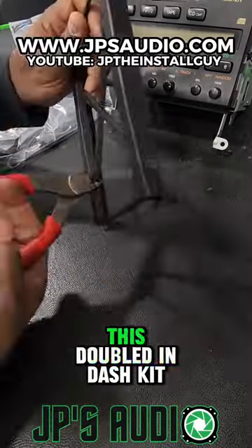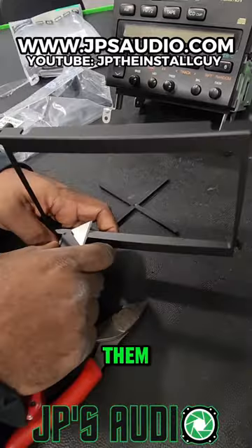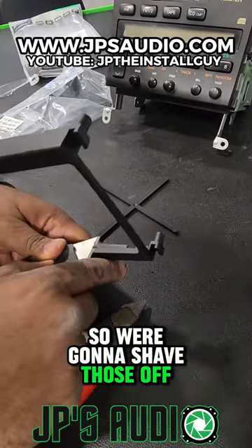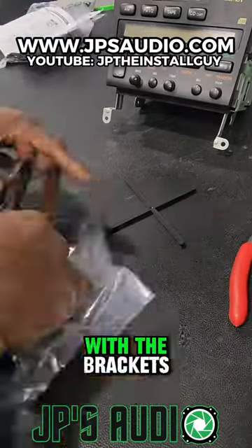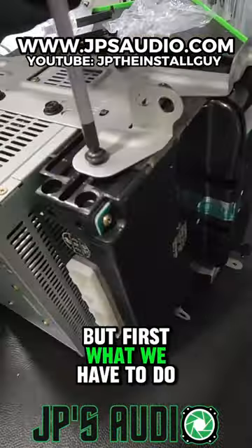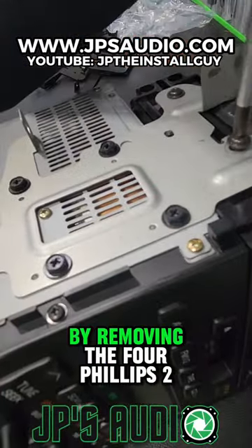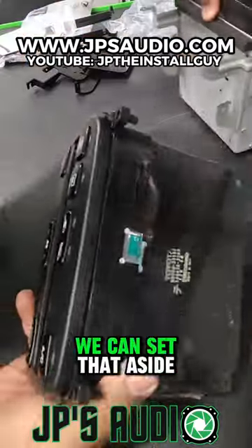Once we disconnect that, now we've got room for activities. We're going to get the dash kit together — this double-DIN dash kit has bars in the middle so we want to cut them. Call me picky, but I don't want those tabs either, so we're going to shave those off to make sure everything is smooth. Then we open up the bag with the brackets, labeled R and L for left and right, which come with four screws. First we have to take the AC module off the original by removing four Phillips screws, two on each side.